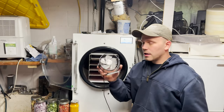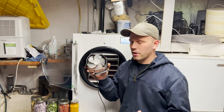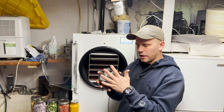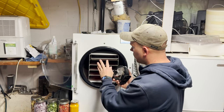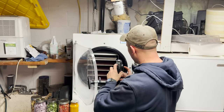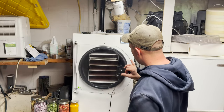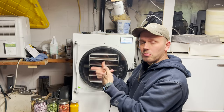The next tip: get yourself a little fan like this. I'll leave a link in the description for this fan because I know it works and it fits perfectly. The cover fell off and it actually makes it easier to fit in here. What I do to defrost this thing faster is when I get to the end of the cycle, I'll hit warm trays, stick this fan in here on the side like this, shut the door, and it blows that heat around and thaws it out much faster.